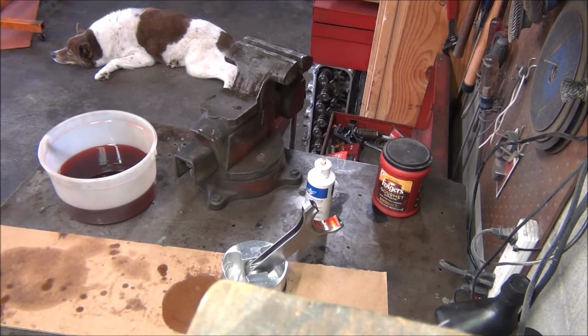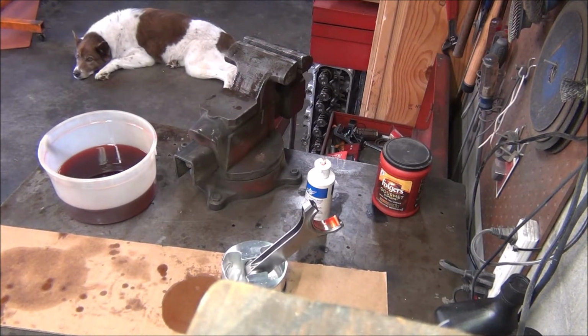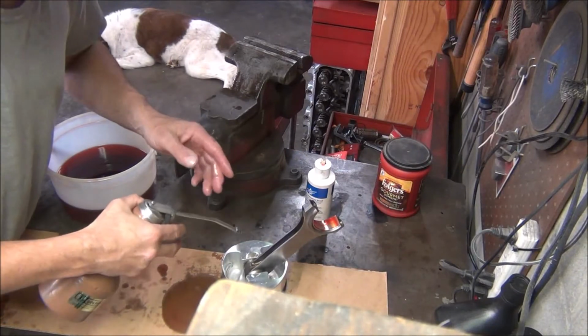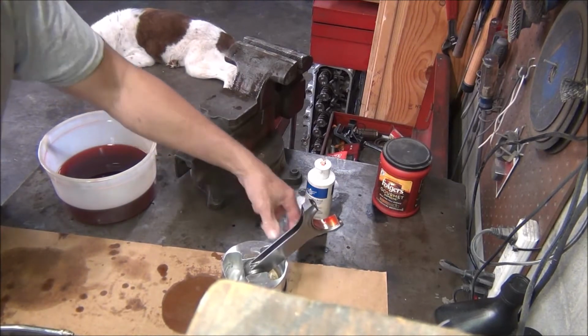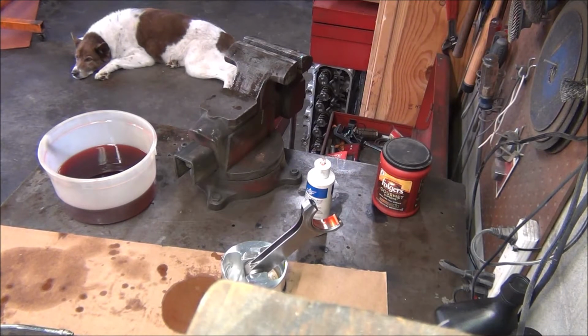And one more thing I want to do. You've already oiled up a wrist pin pretty good. I'm going to add a little more oil to it. I just got some regular 10W40 synthetic here. Spray it on that wrist pin there. Work it in. Don't want to put it together dry. Now we're ready to stick this in the engine.